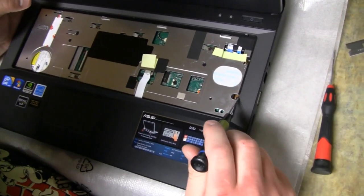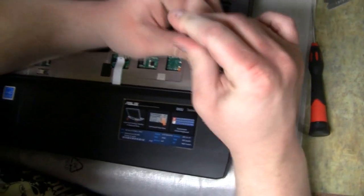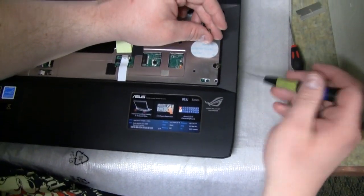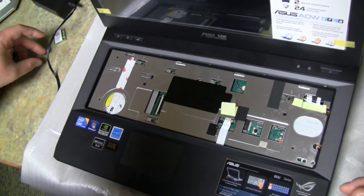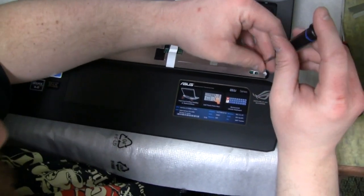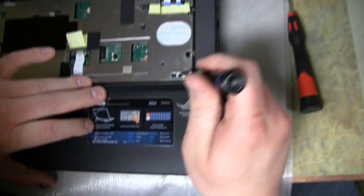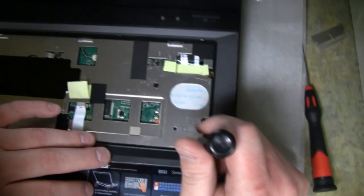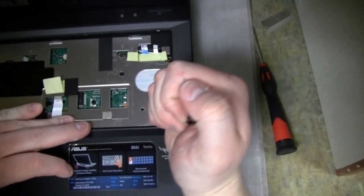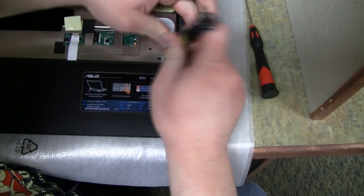Next, we're going to remove these two screws here. None of the other screws under the keyboard need to be touched. This first screw is actually part of the system that connects the bottom plate. The second one holds a locking mechanism in place — that's been deceiving a lot of people who've been trying to unclip it. Instead, put your screwdriver in there but don't press all the way down because your motherboard is underneath. It takes a little force to push it to the side — be careful. You can use two hands to slide it back and forth; just don't press into the motherboard.